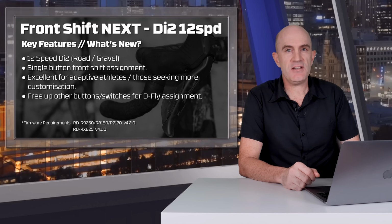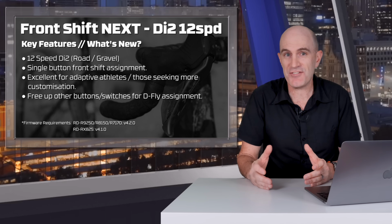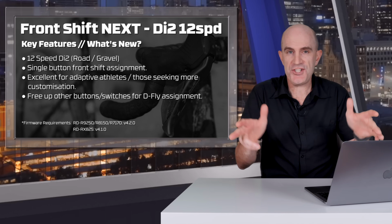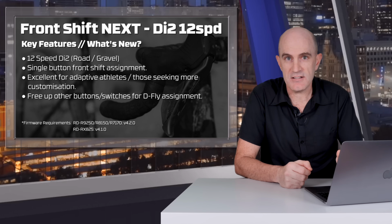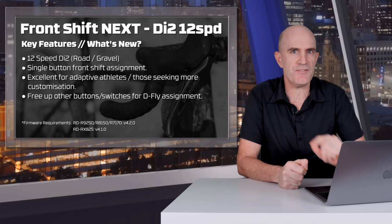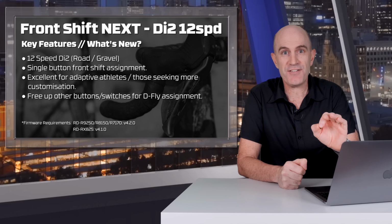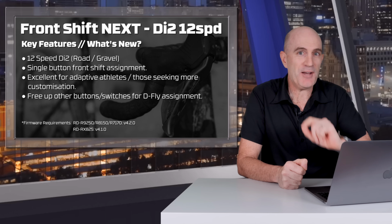Now, if this does sound familiar, yes, it's exactly how SRAM do their front derailleur change as it is. They don't have a front derailleur up or down assignment for buttons, they just have a change button, with the default configuration there assigning the double press to do that gear change on the front derailleur. And with the new SRAM Red and those hidden little buttons at the top, the front change can be assigned to those little buttons as well, but just one of them for now. I'm hoping to see a change to that logic, in addition to front derailleur up and front derailleur down on the SRAM system. They don't have that just yet. Shimano have one up on them there.